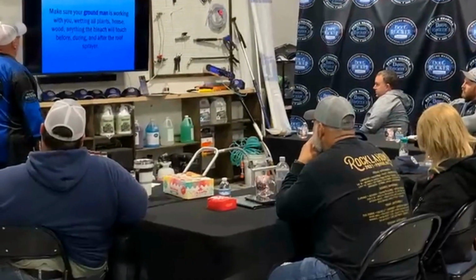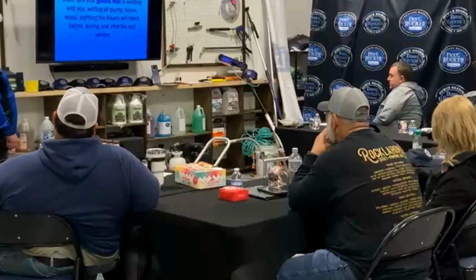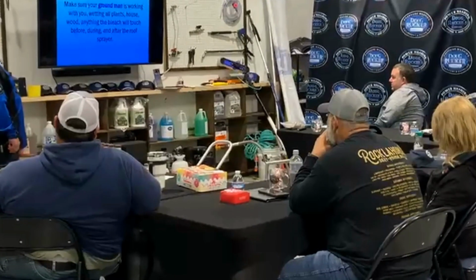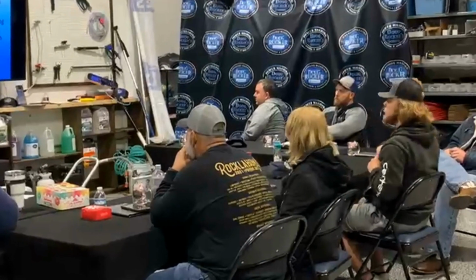So you're working with a ground man. Make sure the ground man is working with you, wetting all the plants, house, wood, anything that bleach is going to touch before, during, and after the roof sprayer.